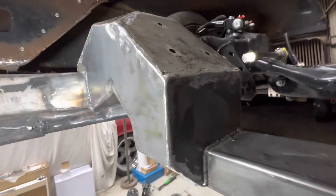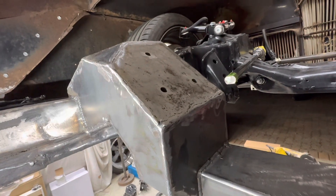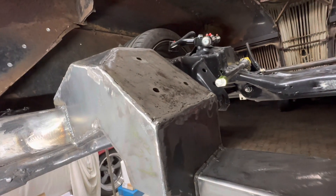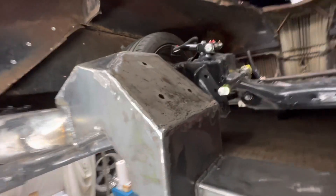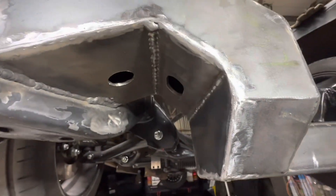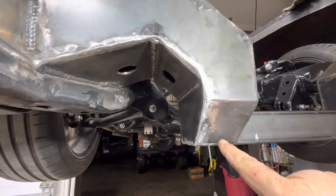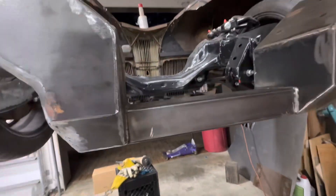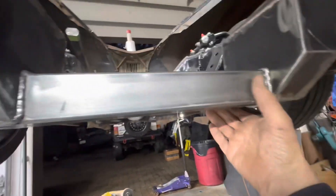These circles and ovals are access holes to the engine mount studs. I learned this on my A-body Chevelle — manufacturers leave holes so you can feed a wobbly-head socket through. I like to feed the bolt through, stab it in there, and put the nut on. Flange heads work either way, but it's easier stabbing through with a socket head. I also realized I should drill a hole on each end of the cavity so any moisture that gets in can drain out.